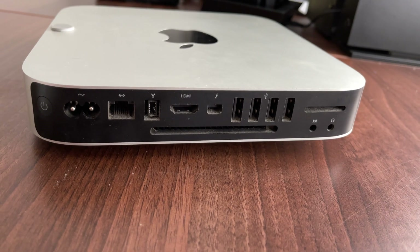So as you can see, just popping the RAM out now — there are two slots there. It's extremely easy to change RAM; you literally take the old one out and put the new one in. As I mentioned, I don't actually have the new RAM to put into this yet, so it would literally just be a two-minute job to swap that out when I've got some.